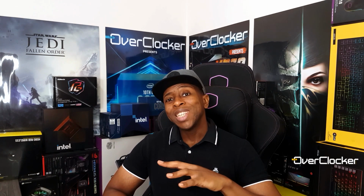So I didn't get to test one of the things that I've always loved about these mini ITX boards from ASRock, and that's memory overclocking. The reason I didn't get to test that is because the kit I have only goes up to 5200, and really it's going to be the same on every single motherboard. It's not going to do any better. 5400 is valid. In fact, you can run 5400 overclocked, but anything higher than that is really not going to go anywhere.